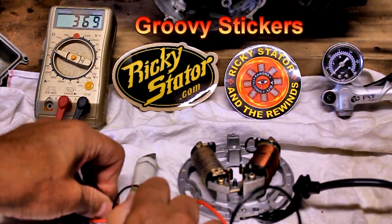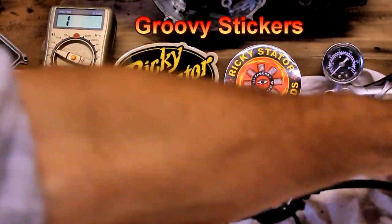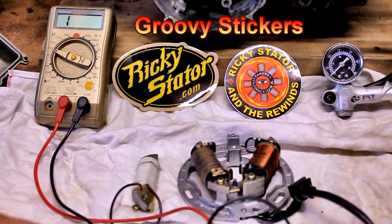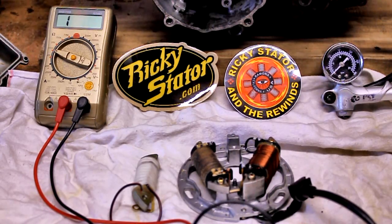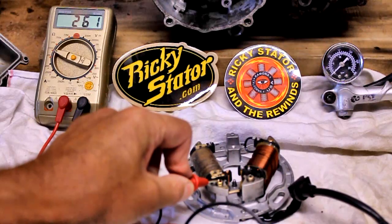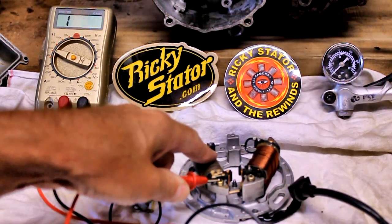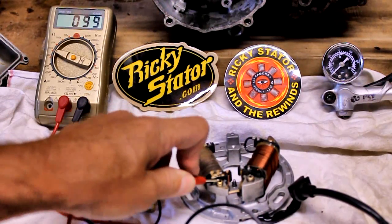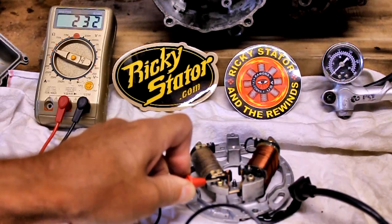Here's the resistance of the new stator, and then I'll do a quick resistance test on the old one which is still on the backing plate. You can see in this test the old one still has a bit of resistance but it was coming and going — if I touch the coil and give it a bit of a push, all of a sudden it goes open circuit. The wire in there is just floating and whether it's connecting or not depends on what's happening.